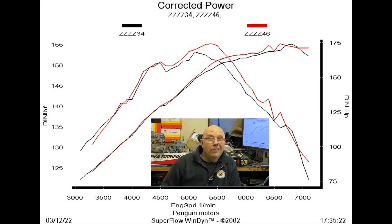As you can see there's not a vast difference, but for sure around about 5500 rpm there's a good bump in the torque curve compared to the distributor. Whether it's worth a grand or more is another matter, but clearly on this engine there isn't a significant advantage.